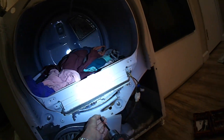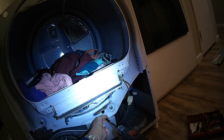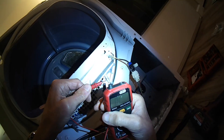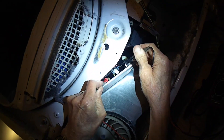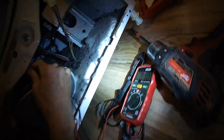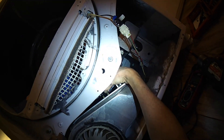The thermal fuse is very often the one that blows when you have an obstructed vent tube. I've pulled off one of the leads and I'm using my continuity tester — I put my leads on there and test it, and I do hear it beeping. So that one has continuity and is not blown. But that's the first one to try.